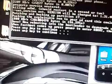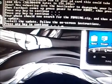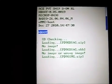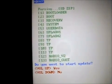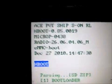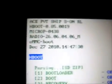Now it says when rebooting into the bootloader to downgrade your Inspire, when fastboot comes up press the power button to enter Hboot, then press Enter on the command console. So now we have entered Hboot and we will press Enter twice. It says your phone should now search for the PD98image.zip and then ask you to install the update. After checking, it says loading PD98image.zip — let's let it work through its process. It says do you want to start the update, and we confirm yes. It says update in progress, do not power off the device. As it goes through this process, we currently have S-on, and we want that to say S-off when this process is finished.